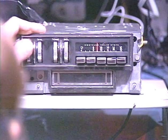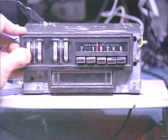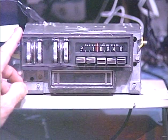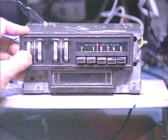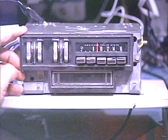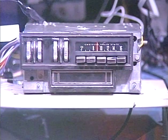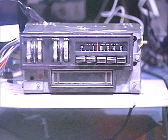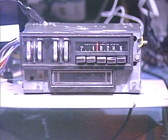Here's our radio back. The only thing left is to activate the Bluetooth and make sure it activates. I'm going to do it by turning the volume control twice in the direction of higher volume. We should hear a female voice saying 'ready to pair' or 'Bluetooth ready to pair.' The unit is now trying to pair with a portable Bluetooth device — I don't have one handy to demonstrate, so in 90 seconds that female voice will come back saying 'pairing not completed.' And that concludes the test.